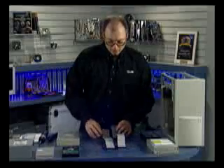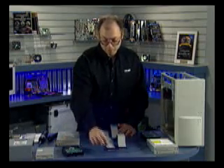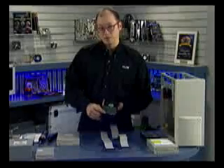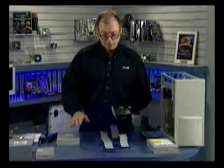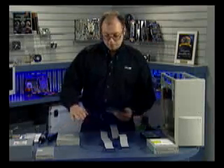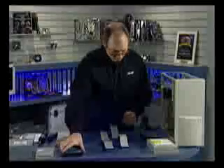Normally the primary master device will be your main hard drive. I'm going to plug this hard drive into the end of the primary cable, making it the primary master device. To determine the master/slave relationship, drives traditionally used jumpers — a master or slave setting — but they also have a third setting called cable select. If you're using 80-conductor cables, you should use the cable select setting on the drive. I'm going to make sure every drive is set to cable select — this one is set by placing the jumper in the CS position.